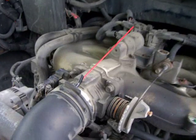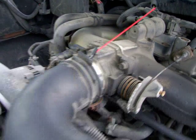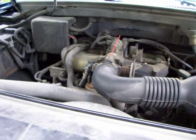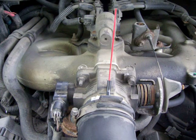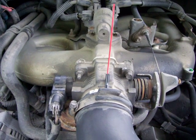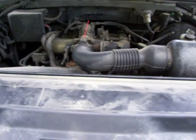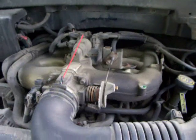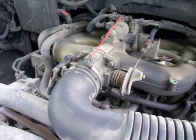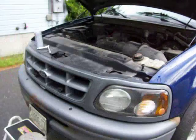And you're supposed to cut that so that the tube is about a 1/4 inch away from the throttle body. Right up here, it hooks right in there. Well, I've already given her a good dose. The truck sounds good. I don't want to plaster it full of fluid, but it says to use a half a can first. And I like how it's idling. So what I'm going to do here is go and do a little bit more.